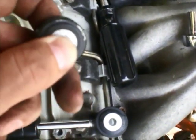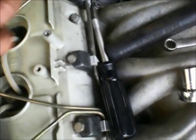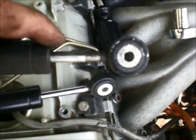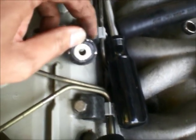I hope this helps when you have the same problem — the rattle in the engine from that noisy tensioner shock. The old one, as you can see, has separated at the top — the rubber separated, actually on both sides. It's completely loose, and that's the rattle: it keeps moving up and down. The new shock holds together — it doesn't rotate, spin, or move freely. The shock mechanism itself still works; it's just these worn bushings making that unacceptable, horrible noise.